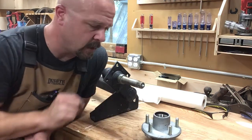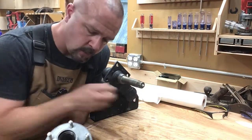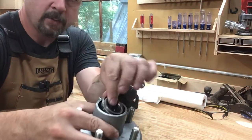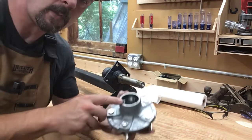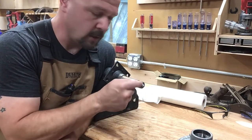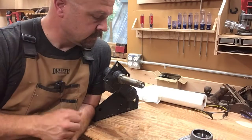This is a brand new axle and a brand new hub and I have brand new bearings, so we'll take it just from clean in case maybe you want to replace your axle. This is a trailer axle — this is the stub, this is where the bearings ride. This is the hub. This hub already has the races installed and the races are tapered, you can see. The bearing is tapered and the bearing, once it's greased, will sit in there just like that and spin around. Two bearings — one on the front, one on the back. A grease seal goes around here that rides on this surface to keep all the grease in. Additionally, this particular axle has an easy lube so there's a grease fitting right here — a zerk — and a hole that goes through here and out here so that you can pull a cap off, hook a grease gun up to that, grease it. The grease will come in the back and push out the front so you can make sure you have fresh grease.